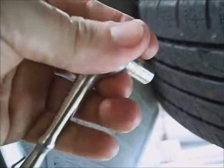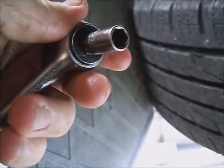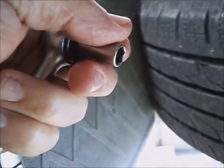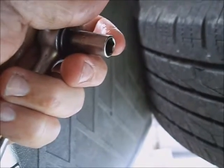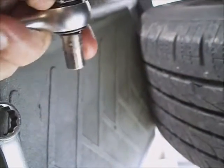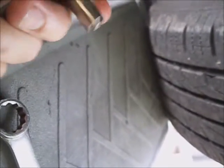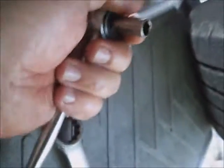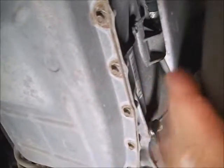On the back six bolts I'll be using a quarter-inch drive ratchet with an 8mm. If the bolt heads aren't too rusty I'll switch to a 5/16ths. Be sure you put the socket on the head of the bolts — especially if they're rusty — solid and square, and break them loose in the back before transmission fluid gets all over them. Then go ahead and start taking the front loose, keeping the socket square against the bolt heads. Try to keep it off the exhaust — it's still hot from running.